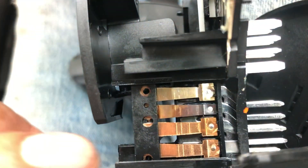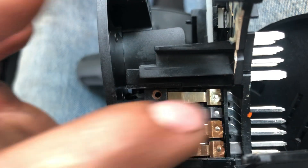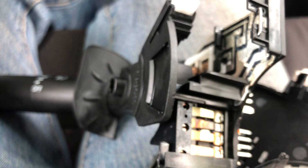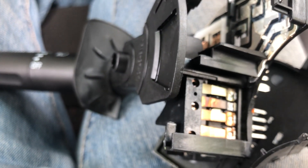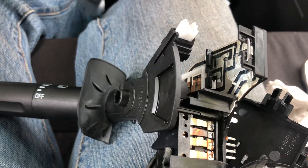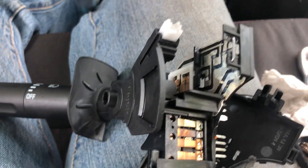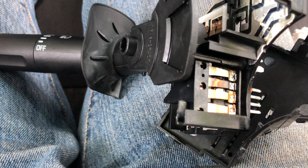The color is melting and it's loose — this connector right here. That is why we don't have a low beam headlight. Because this car has an aftermarket part from the internet, you know, cheap — throwing money away for nothing. It has to be Motorcraft.